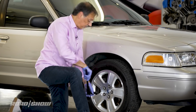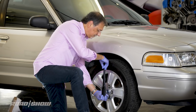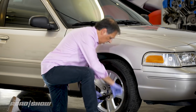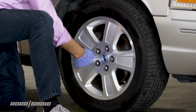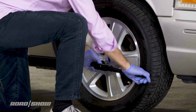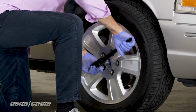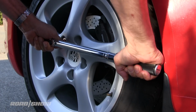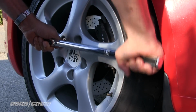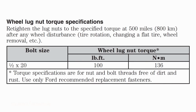Okay, now I'm going to bounce to the opposite one across here. And as you tighten these, you may find that a little more hand tightening is necessary because the wheel is moving in as you tighten each one of these. Okay, and I've got one to go here. And one more on that. Good. Once the flat is fixed and the normal wheel is put back on the car, you would tighten these more precisely with a torque wrench, which is adjustable to a tightness specification that is hopefully listed in your car's owner's manual.